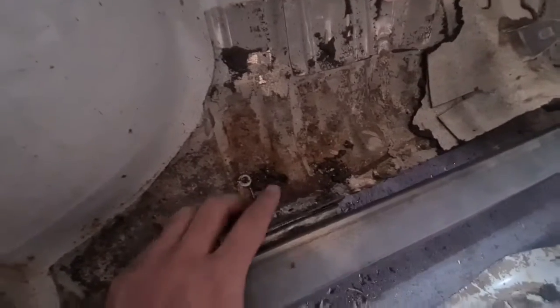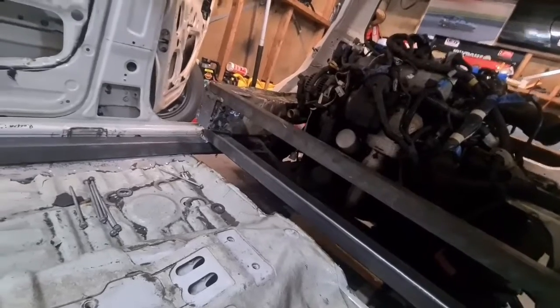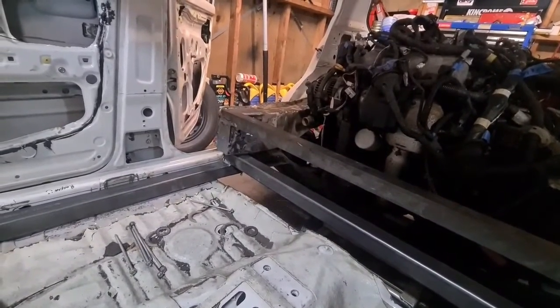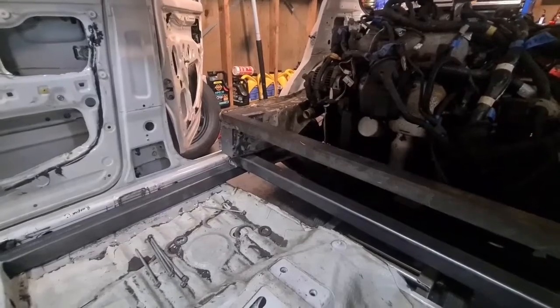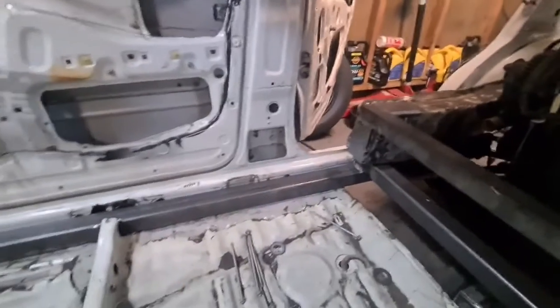This is what I was talking about before, so this is where it mounts, that's the plate to the unibody, that's where that will weld. This is the structure down either side, and across the back sits the rail that the Camry sits on. So that is going to be welded at some point, and then gusseted, probably angle plates up each side, and then a gusset from the top down on an angle, probably stopping about there somewhere, just like that.